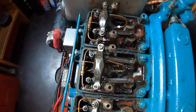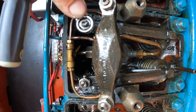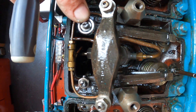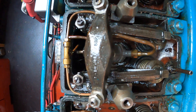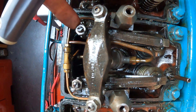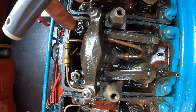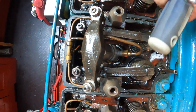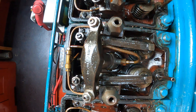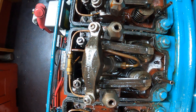I will show you just in case. So this is how you adjust the valve. You've got the lock nut there — the spanner goes on there, half inch. So you just back off the lock nut, and then the screw in the middle is like a grub screw that you adjust with a screwdriver. Basically, undo the lock nut, screw it in a little bit to close the gap down, unscrew a bit to open the gap up, and once we've got the setting right with the feeler gauge, we lock the lock nut back up. And that should be it.